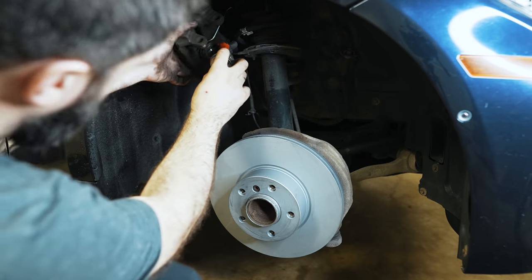When you get to the other side, the only real difference is the inclusion of the pad wear sensor. As you can see, these pads were kind of expired — they didn't have a lot of life left. If you notice on the replacement pads, there's a groove on them. The way I see it, they're due for replacement when that groove is no longer visible. Some pads don't have that groove, but in general these were due.